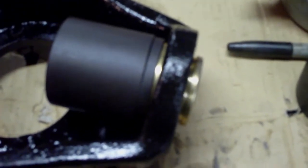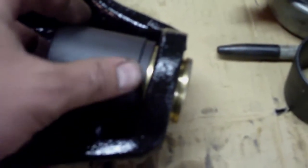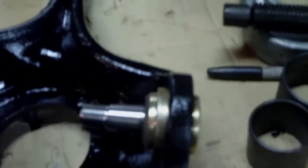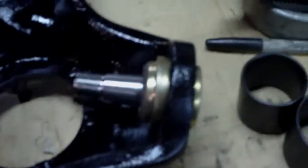This was barely adequate to do it. I was able to do it without anything too weird, but it did take about three different setups before I finally got the ball joint in. If you had a real hydraulic press it probably wouldn't have been an issue — you would have just put the cup on the bottom on your plate and pressed it in from the top with an adapter.